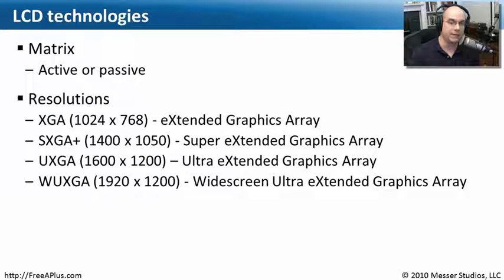You should also keep in mind the different native resolutions you may run into. If a specification says XGA resolution, that refers to Extended Graphics Array, running at a native resolution of 1024x768. If it says WUXGA, that means 1920x1200 — a much bigger, widescreen ultra extended graphics array display. These are things you need to know for your A+ certification exam. It also helps when buying a laptop — for example, UXGA means 1600x1200, and you'll know that right off the top of your head.